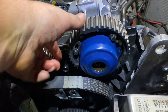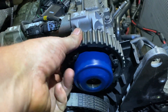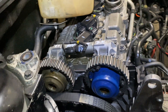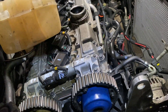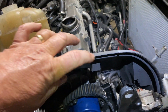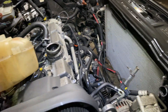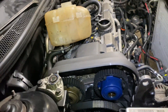You can see I loosened everything — see how it slides. Everything is moving now because the center bolt is loose, it's not all the way out. So the next thing you're going to want to do is put the timing cover back on temporarily, because this cover has the notches. I put little white marks on it so you can see them better. You install this temporarily so you're going to line up your cams.